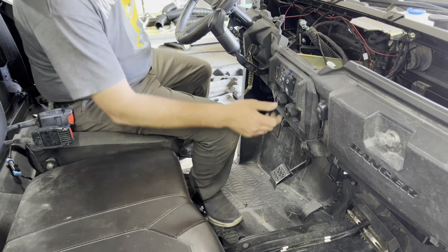And I'm not hitting the hole here. Just want to get it mostly filled up to the top here. And then we're going to open up the bleeder screw on the engine head, for the cylinder head, and we're going to purge the air out of it that way. But first, I'm just getting this mostly filled up. I am a messy mess maker. Okay.